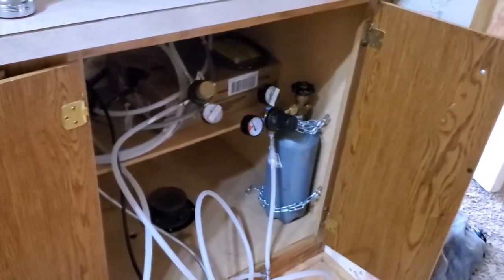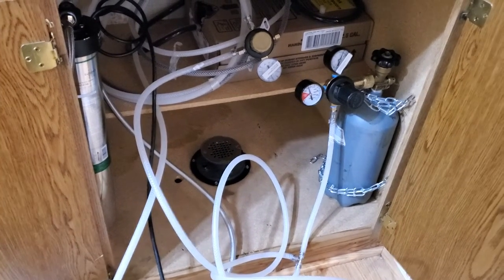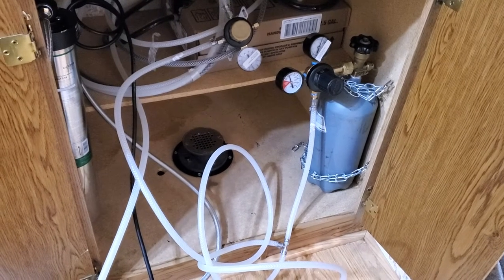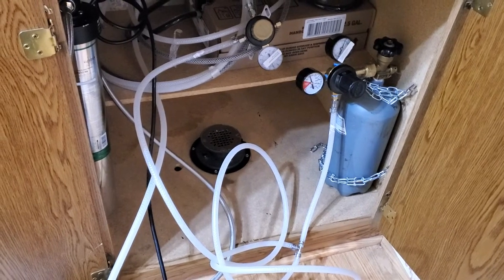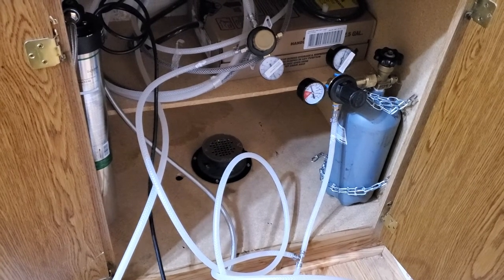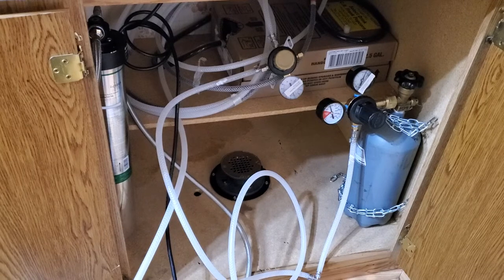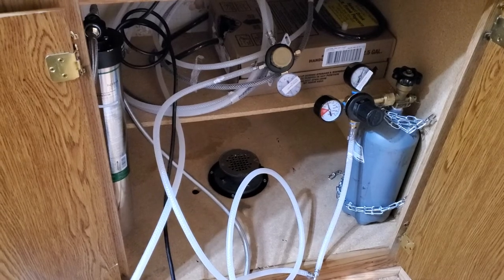That's what you're in for if you want to buy one of these machines — about $2,500 or so. You've got to figure out a way to do this safely and do it right, which is tricky. You're going to want to be prepared for possible water leaks, possible CO2 leaks, and definitely syrup leaks. I have a little experience using these machines in restaurants, and syrup leaks just seem to be something you can't avoid, even though the system is fairly well designed not to leak.